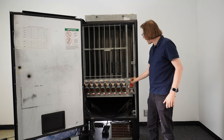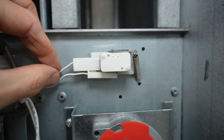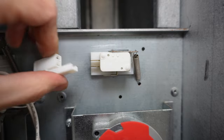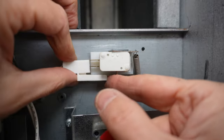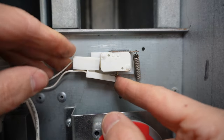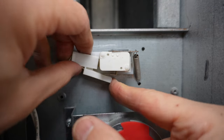Another thing to check is the actual wires going onto the switch. There's a boot that slides onto the micro switch with two wires. A lot of times I have seen where that boot is not fully seated — the common side, which is the very bottom of the cherry switch, has not been seated correctly into the boot, and that would not complete the circuit.